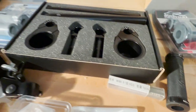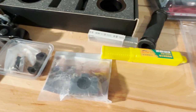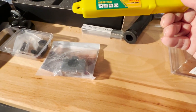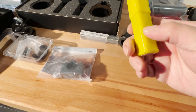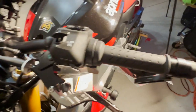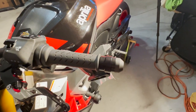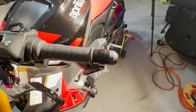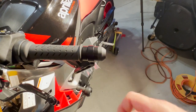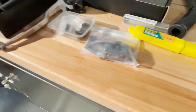The important piece here is the drill bit. What drill bit would you use for an M18 by 1.5 thread? If you do a quick search, the proper drill bit for that is 16.5 millimeter — this is the size for that drill bit. The idea is once installed, I'll use a hand drill and drill about an inch and a half into the handlebar, then use the M18 by 1.5 millimeter tap to create a thread for that insert. Key info to make note of.